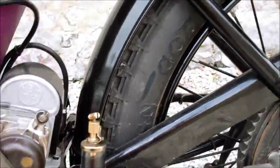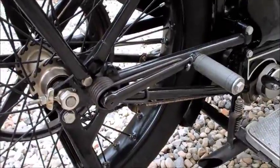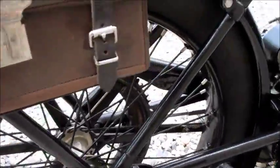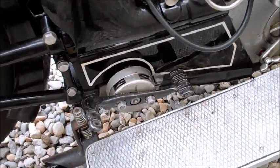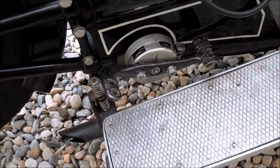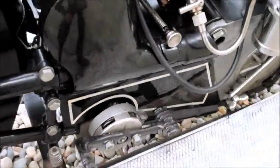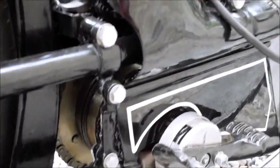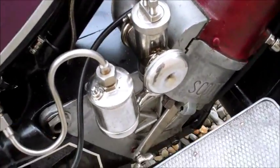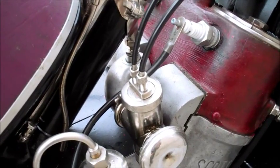The cover is of course the clutch mechanism as well on these 1915 models — the first ever motorcycle with a kick start. There you go, this is the gear change lever for the Scott. You can see 'high' and 'low' written on it. When it's in the central position it's in neutral; when you press it backwards with your heel it engages low gear, which also does the clutch. Pressing forwards is the clutch and the high speed gear. There are two different chains and basically the clutch changes between the two different ratios.